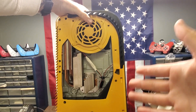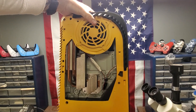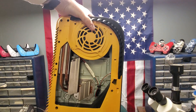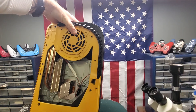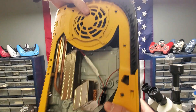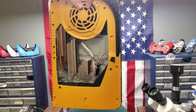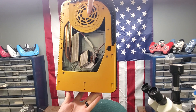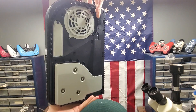This is one of the newer versions — it's obviously modded, so don't mind that. As you can see, this is the heat sink that is actually on the bottom of the board. One difference from the older models to the newer ones is: remember how this motherboard is shaped and you look inside — there's no motherboard up in this corner. That's because the motherboard in the newer ones is a lot smaller than the motherboards in the older models. One of the craziest things for the newest PS5 is that there's a dual-sided heat sink — you have the heat sink on the bottom, but also a heat sink on the top.